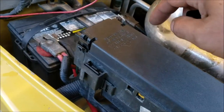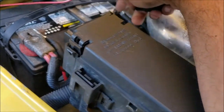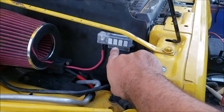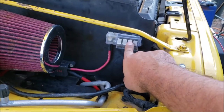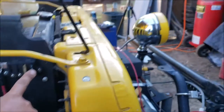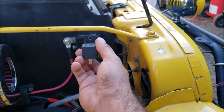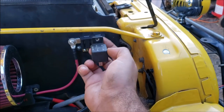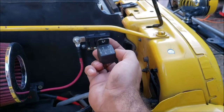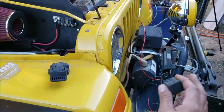If you're gonna be wiring a bunch of accessories, notice we only have the winch cables connected to the battery terminals — go watch my auxiliary fuse box video. That gives us four circuits, and we're gonna be using one of those to power our long-range lights. Wiring up a relay like this can be used for anything: cooling fans, air horns, lights, light bars — whatever you want.